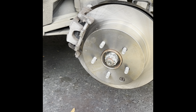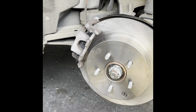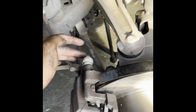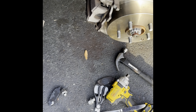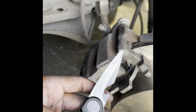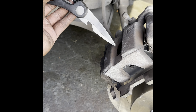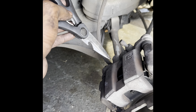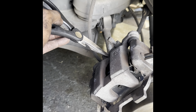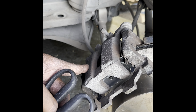I didn't film the first one because I had to give it a shot myself. I struggled a little bit, but it wasn't that bad and I got it all figured out now. You need a 14mm for these bolts and a 19mm for these bolts. Before you get started, you want to push that piston back — it's going to help. I have scissors since I don't have a pry bar, but you come in here and just push it back. That piston goes back into the caliper, so later on when we put this back on, it's a lot easier. After you're done, you want to get in your car and press the brakes like three to five times.